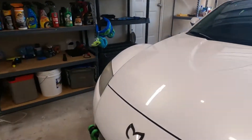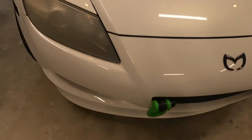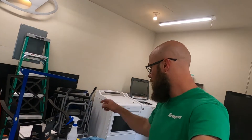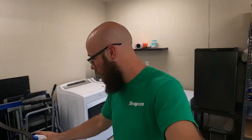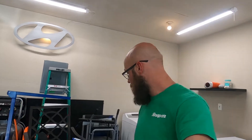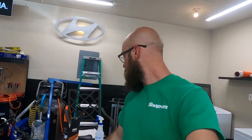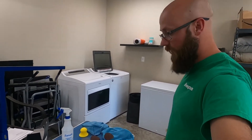Once you get the headlight clean, as you can tell it's already kind of cleared up quite a bit. Once you get that clean, what you'll need is some water — I've got a spray bottle here with a little bit of soap and water, just a couple drops of soap, mostly water. You are going to take the 2000 grit sandpaper and your sanding pad and sand the headlight in a linear motion. For some reason they want you to do linear and not circular, so I'm just going to follow the instructions and do it their way.